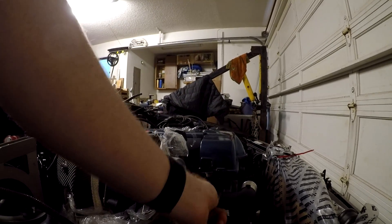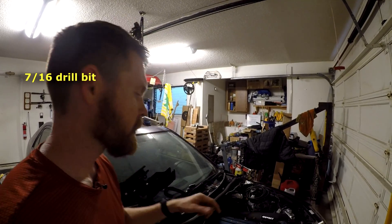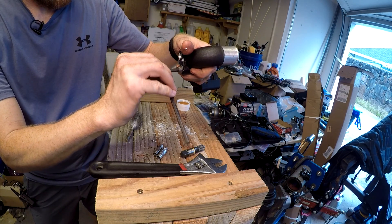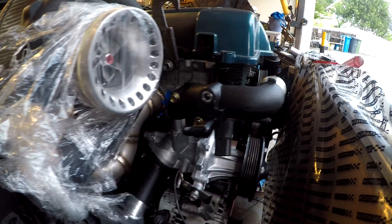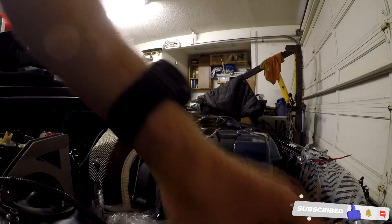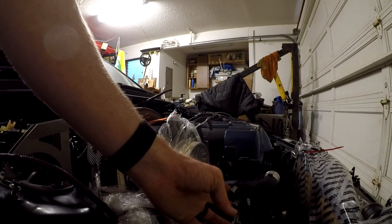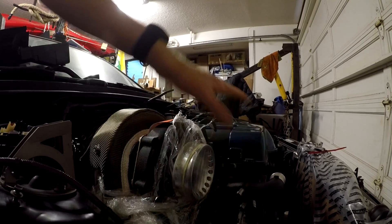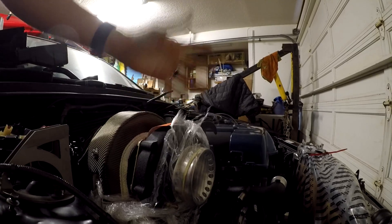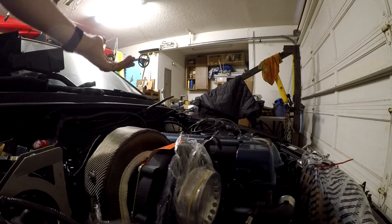After they're out, I'll unbolt it from the engine, run my drill bit through it, and then run the quarter inch NPT tap through — that's the plug size I have and it's a fairly common size. I'll be able to run a hose off of it with a little 45 degree silicone coupler. The two old coolant feeds will be plugged, and in the future I can put a 1/8 MPT fitting inside if I need to run it to something else.